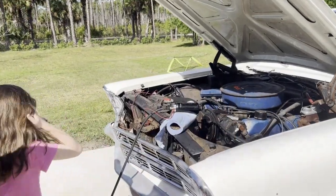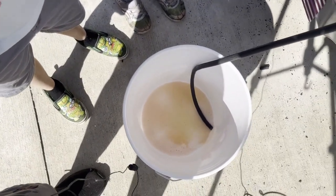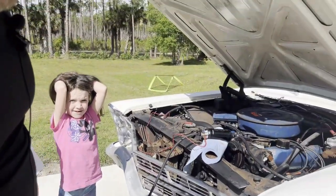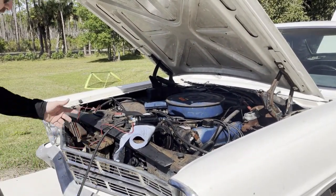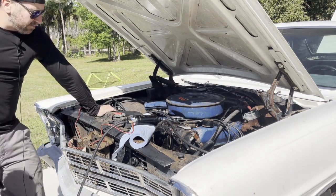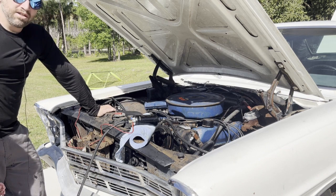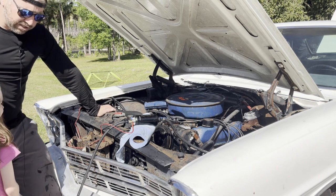I have my little extra fuel pump and we just pour the bad gas into the bucket. After I emptied it the first time I put Marvel Mystery Oil in it, so that's why it's a little red. I've also already put Marvel Mystery Oil down each plug hole. Once we get this drained and put some fresh gas in it — I don't have a key for this car yet, I ordered an ignition but it hasn't come in, so I'll just jump the coil. Stay tuned.